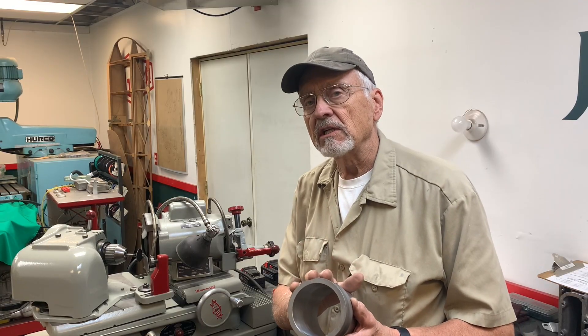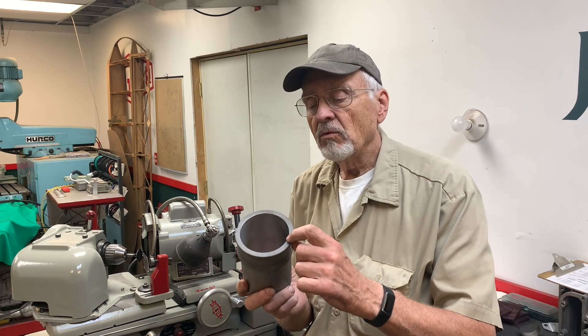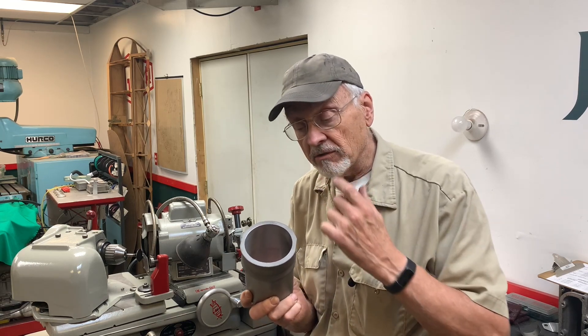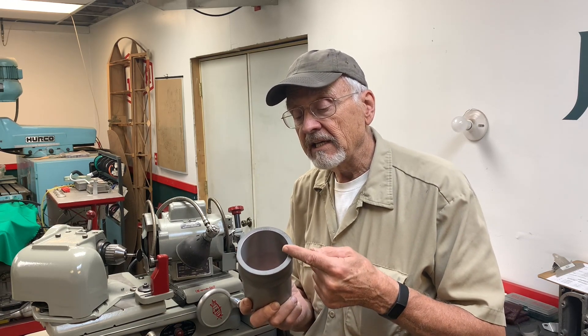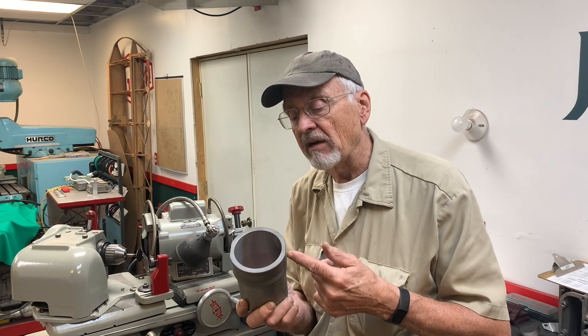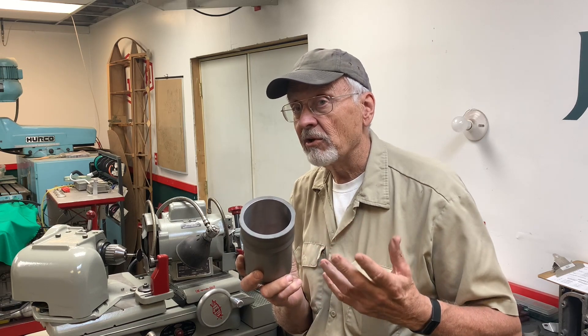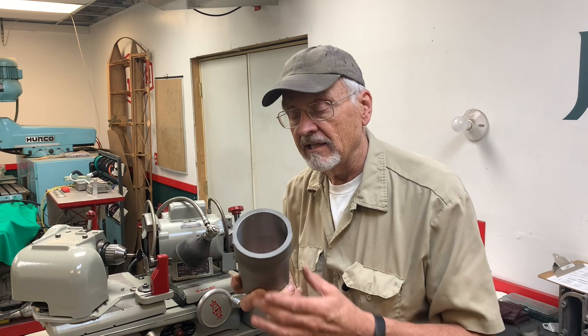Now if you're going to be reusing your liners, check that they're in spec in terms of diameter, out of round, and also taper. You also need to look at the liners right about here in this area, where Jaguar had a real problem early on with the introduction of the V12. They can get cracks — most prevalent in these areas where it's milled down a little bit. That's really important because maybe you took your engine apart for overheating thinking you had a cylinder head gasket problem, but it turned out you had a cracked liner and you put the same cracked liner back in again. Not a good idea.